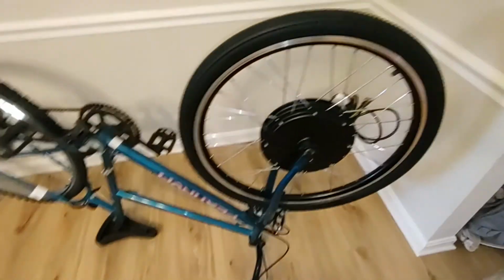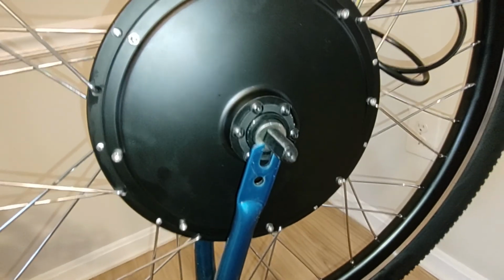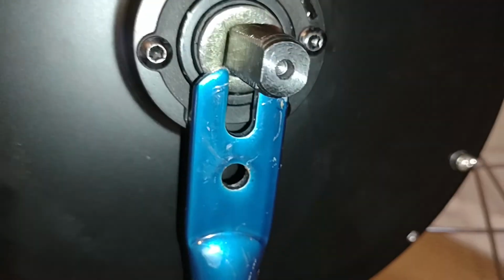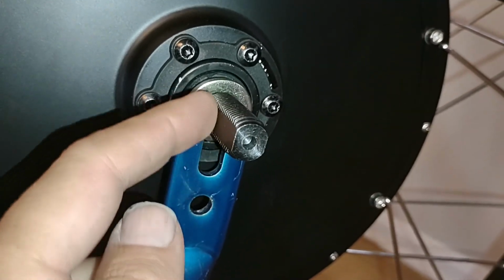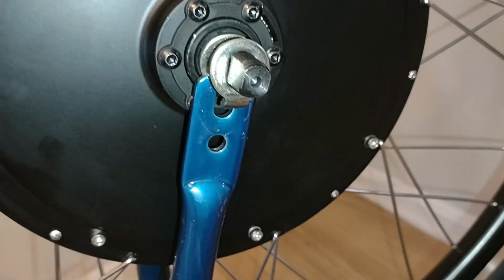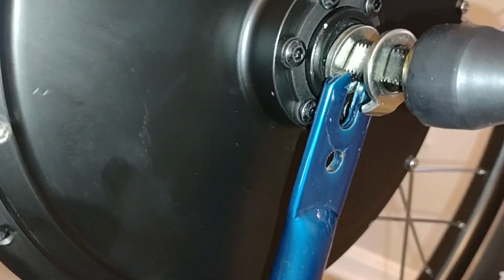Okay, so let's take a closer look at this. So I took off some of these parts, the nut, and there's a little thing that holds it in place. Okay, so I rotated this so that the flats should go down into the shaft, but it looks like it is too thick by a little bit. So what I may do is end up modifying this so it can accept other tires rather than modifying this flat. This is probably going to be hard to grind down. It'd be easier to grind this notch out a little bit. And again, these parts were on it before. This would hold it in place. It's got kind of a square washer, which probably latches into that thing. And then a nut to screw it down. So that's how it'll look when it's finalized, but looks like it's too thick to fit into our bike fork right now.